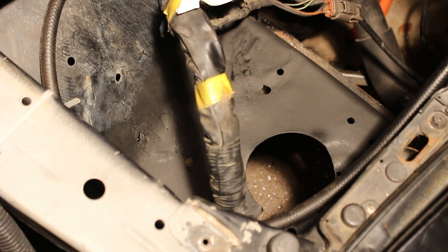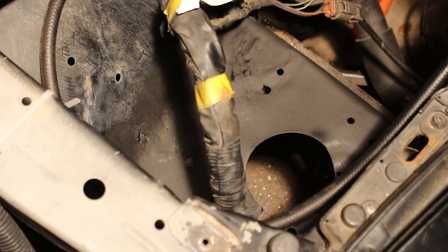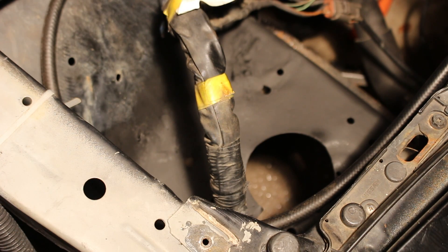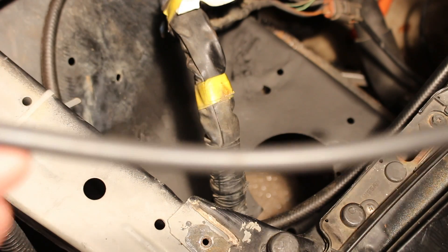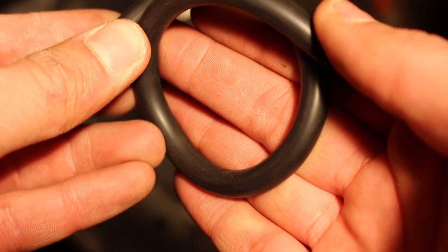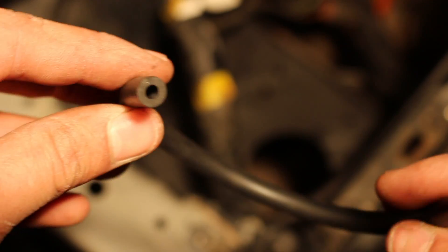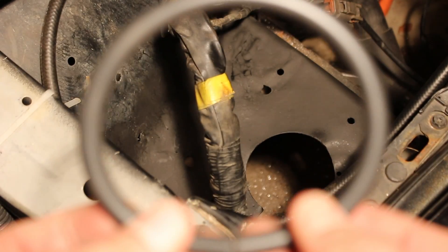Since the paint is pretty much dry — and don't worry, that's not me, that's just dirty — I just painted this bottom part and it looks a whole lot better than before, so pretty pumped about that. Obviously we don't want sharp edges touching and coming in contact with the intercooler piping because eventually that will rub through. So what we do is take a bit of vacuum line — this is actually just some windshield wiper hose you can get from AutoZone, I believe this is 5/32, doesn't really matter, just get the small one — go ahead and cut it right in half and then line it right around your hole.